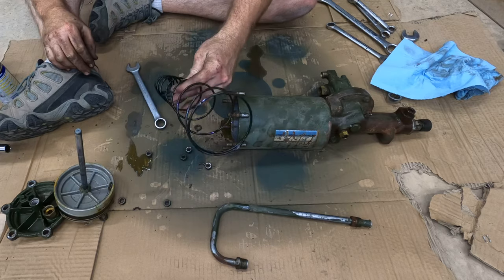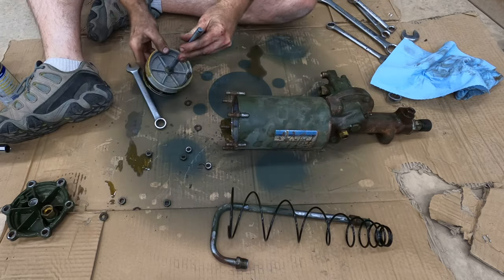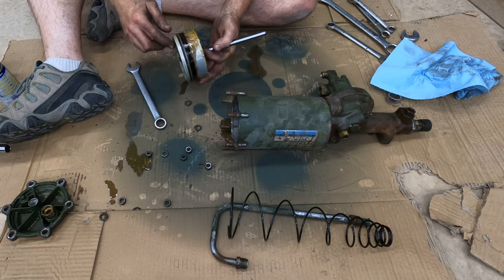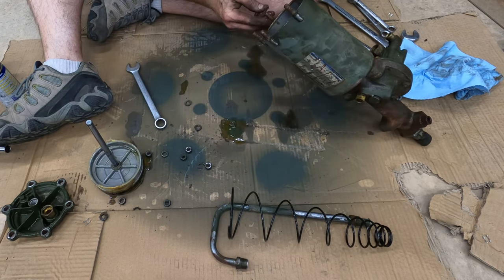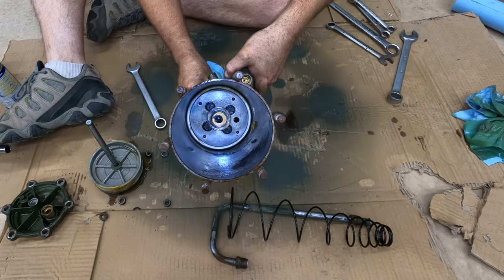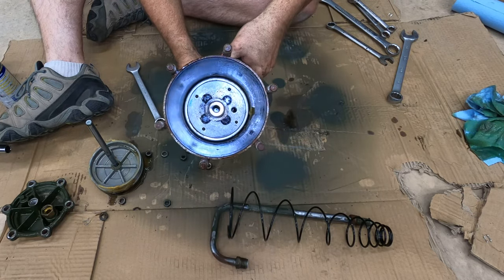Okay, first observation, my spring looks pretty good. Secondly, there's some of the petroleum jelly used to put this thing together originally. Thirdly, it has brake fluid, but no pitting. I am lucky. Have a look. No pitting. It's just a good clean cylinder.